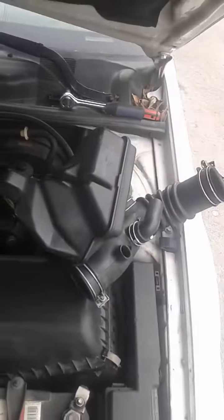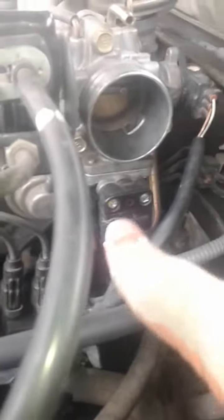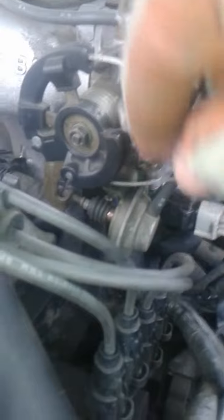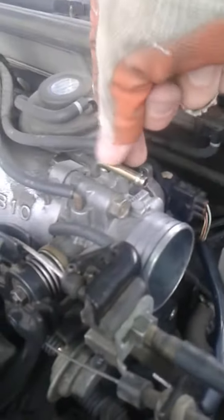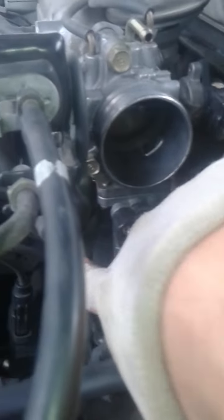I've removed the hose part so I can see the throttle body more clearly. I've got to take out those nuts at the bottom, take out those two screws right there, and loosen these two nuts so I can get these wires and cables off. Whatever you do, do not take off this nut — just leave that nut on there. Just unhook these cables from there, and take these things off without breaking the tubes, so you can take this thing off — because the idle air control valve is right under here.